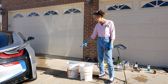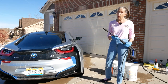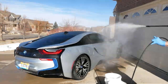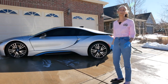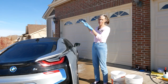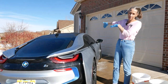We're all set with our buckets. We've got our wash in one and our rinse in the other — I actually have three because I know I'm going to need a lot of soap. Two of these are soap and one is a rinse. The car is quite dry at this point, so I want to rehydrate it. Our foam is still on the car and it'll rehydrate right back up. I'm going to give it a light misting just to re-wet the car without washing off the soap. When you can't help it and your car is in the sun, I like to wash the part that's in the sun first, working my way to the shadier side.